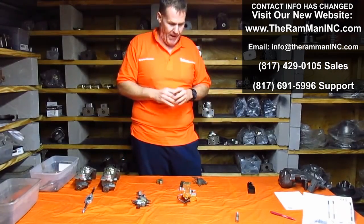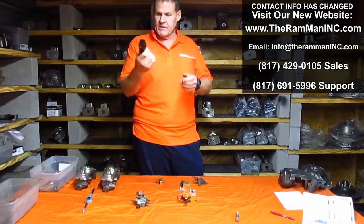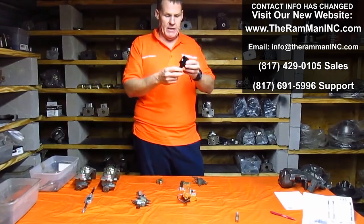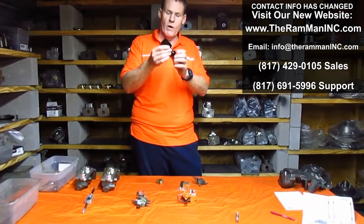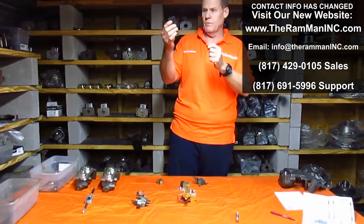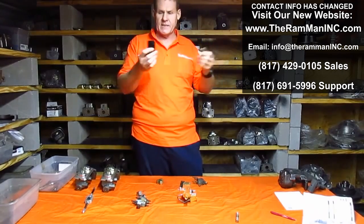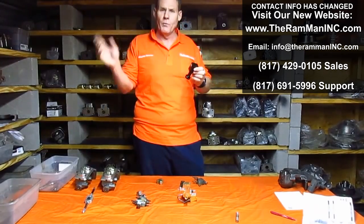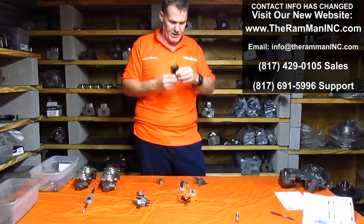That's a little breakdown of our factory valves, and then you run up against this little simple gizmo right here. This is what you'd call an adjustable valve. You can hook this up in line on just your rear line, and it's got a thumb wheel where you can adjust the cut-in pressure and how it behaves. You hook this up on just your rear line, go out to your stadium parking lot or country road, and practice four, five, six, eight stops from 40 or 50 miles an hour. You dial it in until you get really good braking on the rear end without getting a whole lot of slides. This is your adjustable right here.